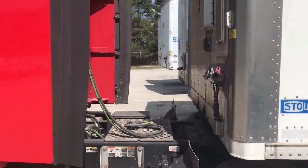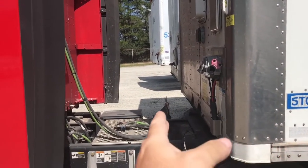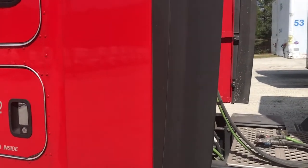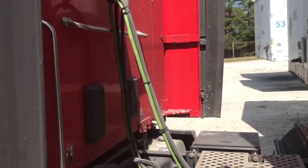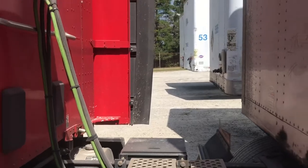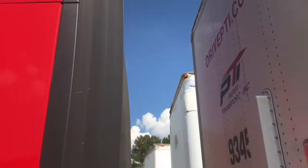With the trailer on it may be a little easier to see. If you move the trailer farther forward you'll start running into a collision risk with your cab extenders here. I'm sure some of y'all have seen trucks around with these things all busted up — that's what happens. If they're too close and you turn, they'll hit, or going up and down over hills the trailer flexes and they'll hit up top.